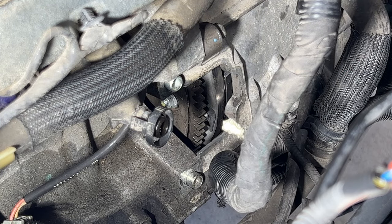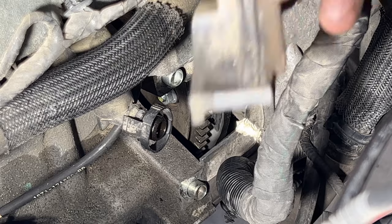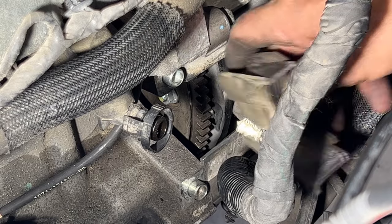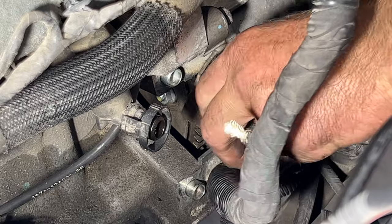Okay, right there, guys. That should be all set right at around 18 foot-pounds or so. So with those tight, let's go ahead and get our starter in now. Take your rubber piece here, the little insert, and get that placed in here.